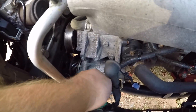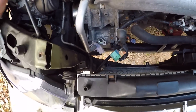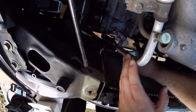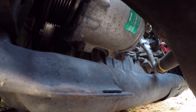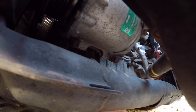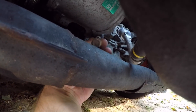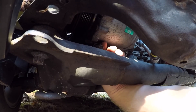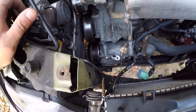I have one, two on top and then there's two on the bottom — those are 12 millimeter bolts — then I should be able to get the compressor out through the top. For the bottom bolts, crawl underneath the car and get the two bottom 12 millimeters out. Here's your subframe — the compressor is right here. One of the bolts we want to get out is right there and then the other one is gonna be right there. All bolts are out and everything is disconnected from the compressor — it should slide right out.